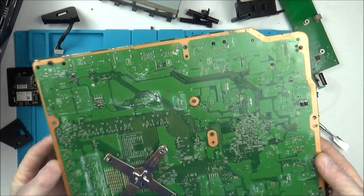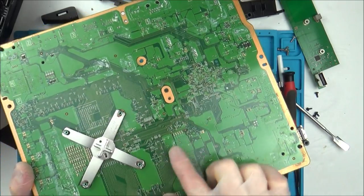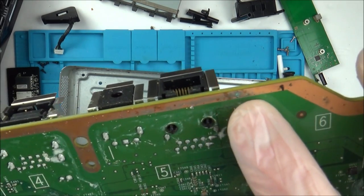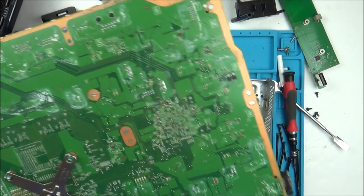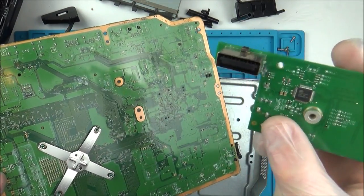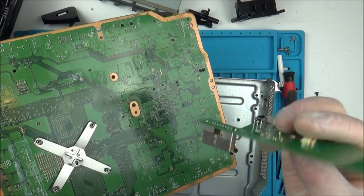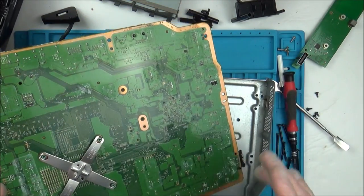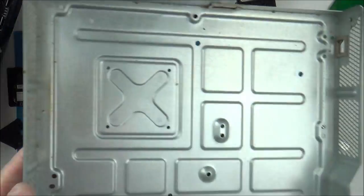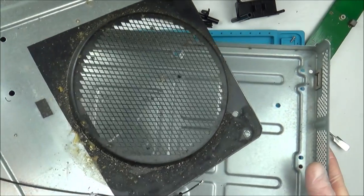Right, okay, so I've got that out there now. You can see a lot of marks here, but that's normal. I remember that on the first Xbox that I took apart, and that's just the residue from the original flux. So you can see it's in a sort of pattern. So that's all actually normal. But this bit here wouldn't be normal. Can you see a little bit of green there? I don't think that would be normal. So yeah, I think something's definitely fallen down on top of this board, and maybe it was shorting on here or something when it was wet. Could it be possible, if this is the power board, that maybe it was turning itself off through corrosion rather than actually recognising when the finger touches the front? I mean, I really don't know, but to be fair, this bit here doesn't look too bad. Yes, it's grimy, but it seems to be the top of the Xbox that got the brunt of it rather than the bottom. I mean, if you compare that to that, there's no comparison.